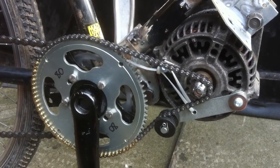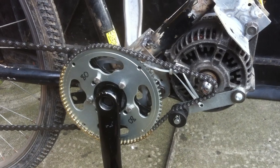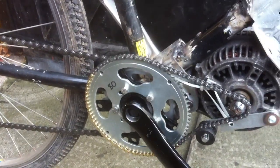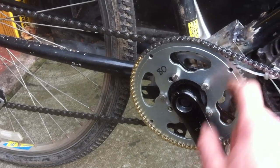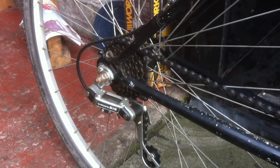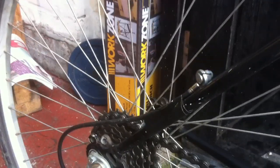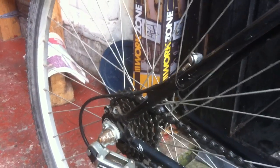I shall wear steely boots in case that chain gets ripped off near my ankles. There's a bit of a concern that this is going to turn and break my legs off, but that's not going to happen because this is a freewheeling crank. The idea is that I can pedal along normally — I've got a 30-tooth drive sprocket behind here going to the normal 6-speed gear cluster, which is 28-14. I've had to cut the cable off for the time being, so I've just fixed it on a gear with a little crimp on the cable, held up at the 24-tooth.